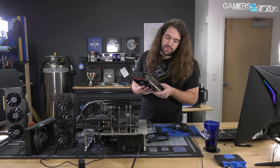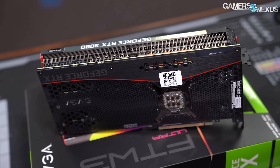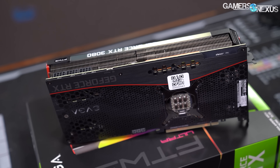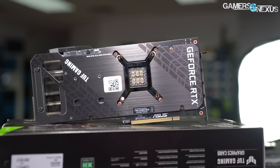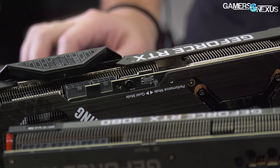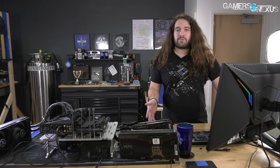For additional features, there's a vBIOS switch — we ran the OC mode, but there's also a normal mode. There's a vBIOS switch on at least two of the cards; I have to inspect the Eagle more closely. We ran the performance mode for both. Asus calls them performance and quiet modes. A dual BIOS switch just means there are two BIOS profiles written to firmware — typically a quiet and an OC profile. The outcome is a lower power target on the quiet one with a less aggressive fan curve, because there's less power to deal with. We ran the higher-performing ones for everything tonight.